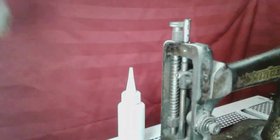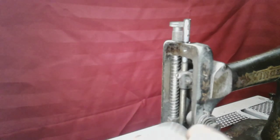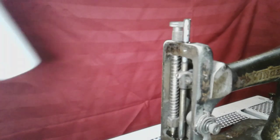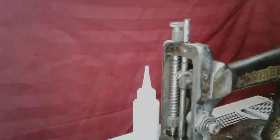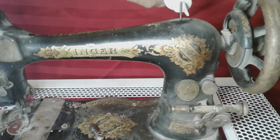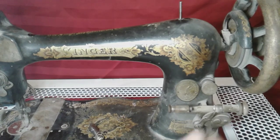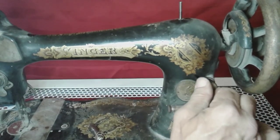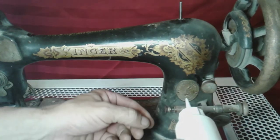I'm not sure if you like all the content I make, but I'm happy you come along anyway — I'm having fun doing this, hopefully you guys are learning some stuff too. That's done, let's get the cover on and start moving down with some oil. I'm going to put two drops in each of these holes — because this machine has a lot of dust, I don't think too much oil will hurt it. The stitch knob is sticking out, that's not seized — that's good. Let's get some oil on that and set it to the longest stitch.